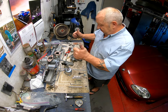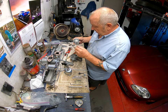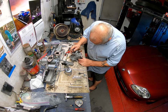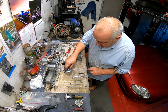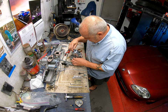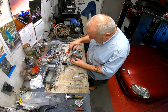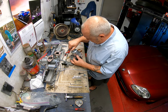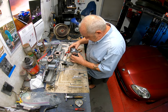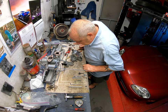All right, so we have here the slide and a nicely cleaned needle that needs to go in here. Then let me get our nicely polished top. Obviously this is all going together dry - you must make sure you fill this dashpot full of oil up to the bottom of the neck where it shows you it should be. If you don't know where, look at the manual. That lines up beautifully.